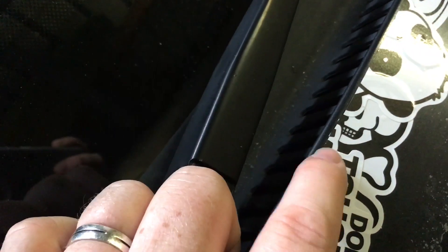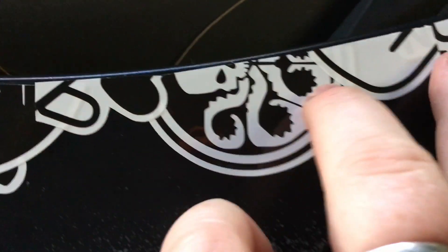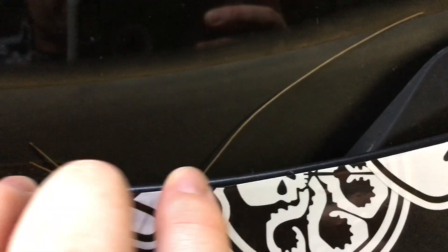I've managed to lay this whole section down without doing any cutting along this flat edge, so that's good. Just remember you want to set it back a little bit from the lip — make sure it stops on the flat of the hood rather than going over the curve. As soon as you start going over the curve or the lip of the steel, that's when the sticker will start to lift. I actually found a better technique than scouring the paint with a scalpel: cut your stickers short, put your big ones in place and then cut some short stickers to overlap. You won't get a perfect curve — you'll get a bit of an angled curve — but it's better than running the scalpel through your paint, and it's only on close inspection that you can see those angles change.